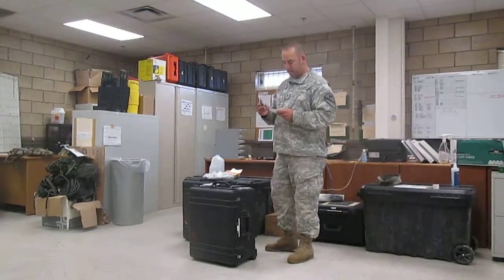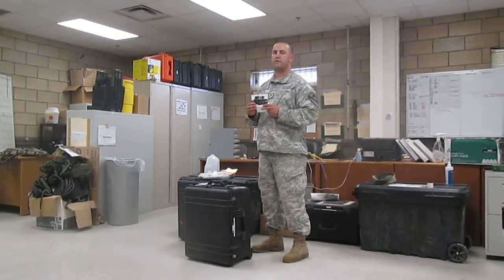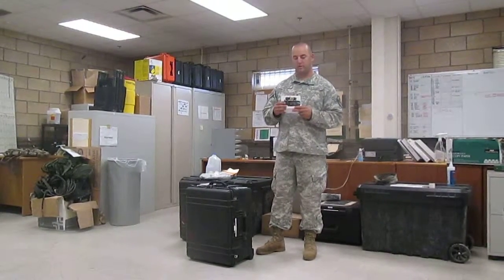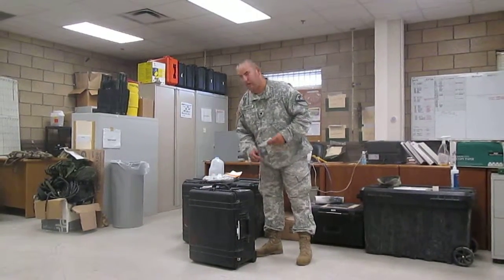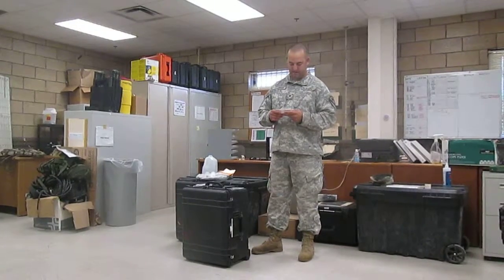Scotty Kilmer recommends that you use a breaker bar or a large screwdriver on hard to reach starters, because sometimes you don't have enough space to actually swing the sledgehammer into the starter. Now, the first time I saw somebody do this, I thought it was a joke. But ladies and gentlemen, I'm here to tell you that it works, and I have personally done it myself.